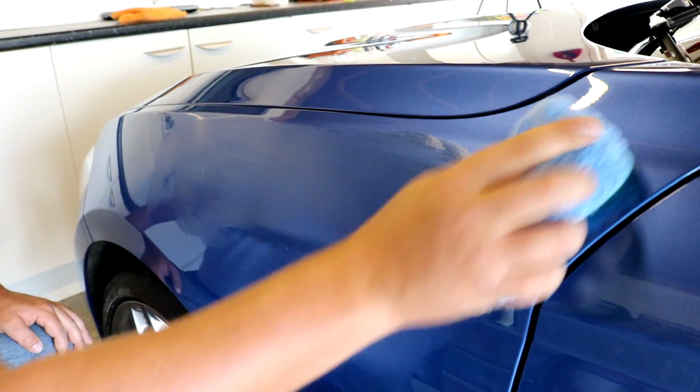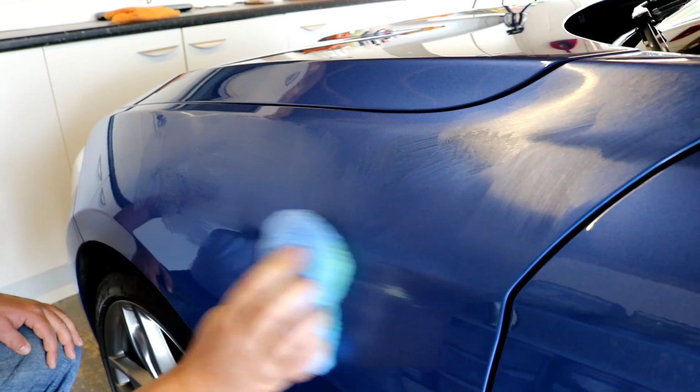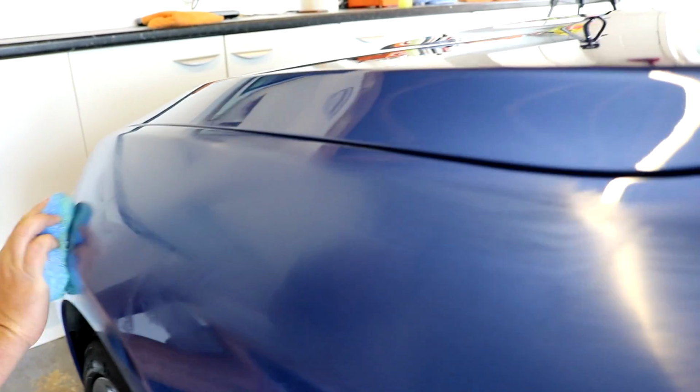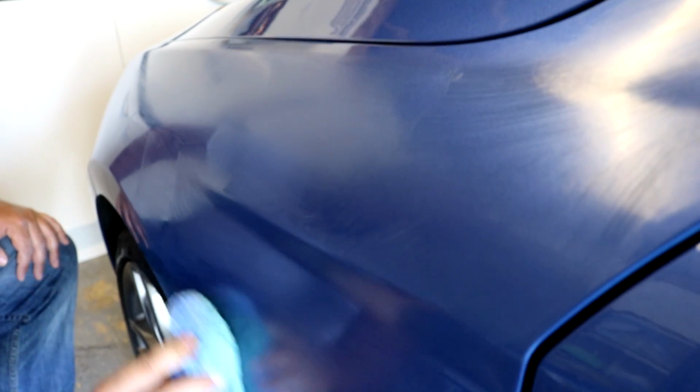So the flip side and the positive to that negative side of perhaps less weathering and resistance to washing that you'll get with an emulsion, the positive, for me, is the fact this product generally will contain a lot less solvent than a typical paste wax, which could be 45 or maybe up to 60% solvent, and typically a mineral spirit based solvent. That high concentration in paste wax, combined with potentially longer cure times of leaving them on the panels for 10 to 15 minutes, sometimes even longer, means that the risk of your top coat, we'll refer to these as top coat type products if you like, the risk of that product being used as a top coat compromising what's underneath it is reduced, okay?